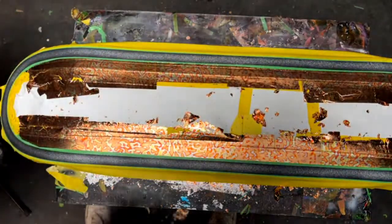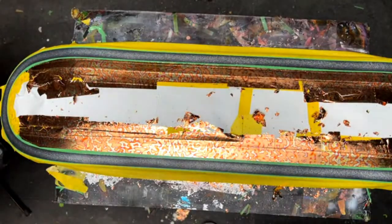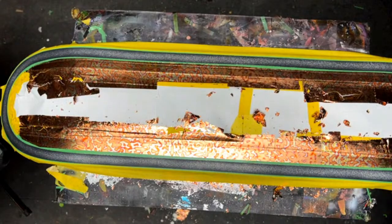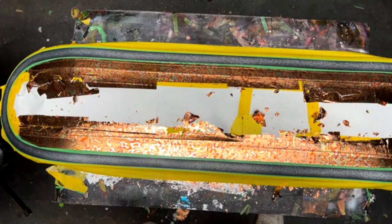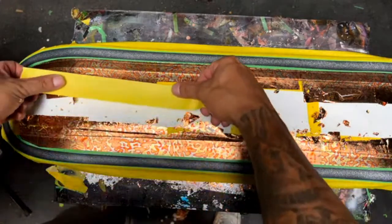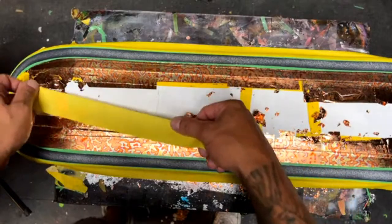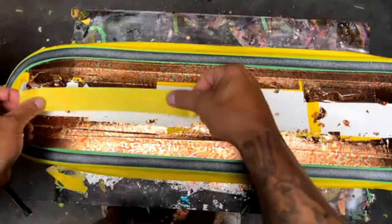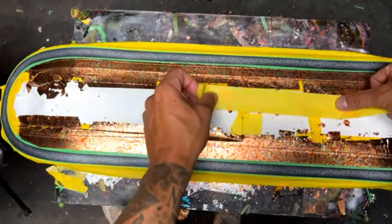Okay, I'll quit babbling. Does vulcanizing glue have a shelf life? Yes, it does. When I get it, it has a shelf life of 3 years. But we're usually in and out of them through circulating within 6 months, so you would have an average of 2 years with that, but longer if it doesn't dry up. If it's not dry in the bottle, you're good to use it.